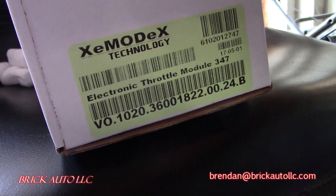Welcome back to BrickAuto. We're working on a 2001 Volvo V70 Turbo. We actually tried cleaning the ETM with no avail — it did not help the surging, pulsing idle. The owner took it back after the cleaning, drove it around a little bit, but there are no guarantees with that. It just needs a new ETM, and it had already been replaced once under the extended warranty. So it was towed back and now we're going to replace the ETM.